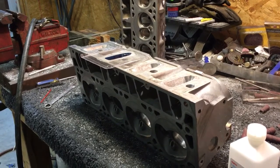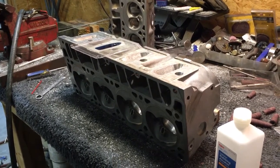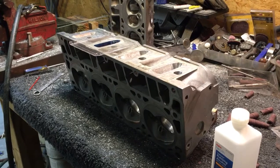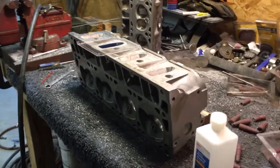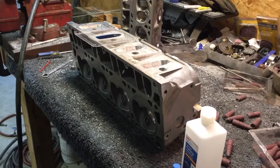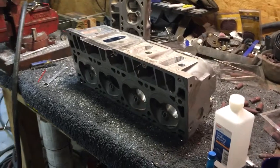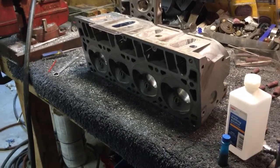That's a word of advice on how to make good power without hogging your heads out. I guarantee 275 CFM of air just on the intake, and this thing's going to flow 200 plus — I'd say around 210 plus CFM on the exhaust port. I'm probably going to go ahead and CC one of those exhaust ports too, but you're probably only going to get to see the CCing of the intake port. I'm very happy with the results — it came out exactly where I was shooting for, so I can guarantee the heads will flow properly in the range I guaranteed. That's CCing your cylinder heads on the cheap. Anybody can do it — it just takes a little patience and some low-dollar components. Thanks for watching.